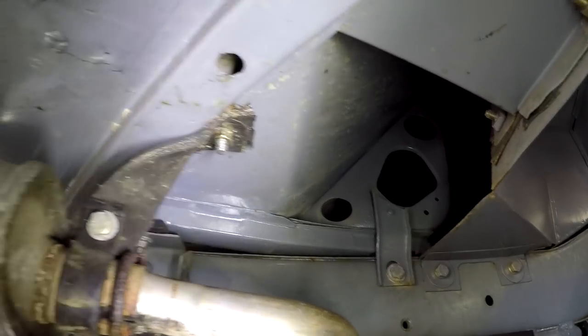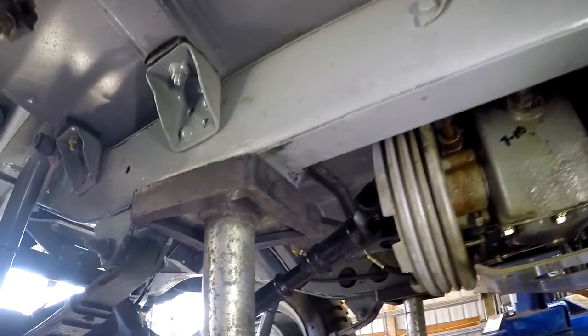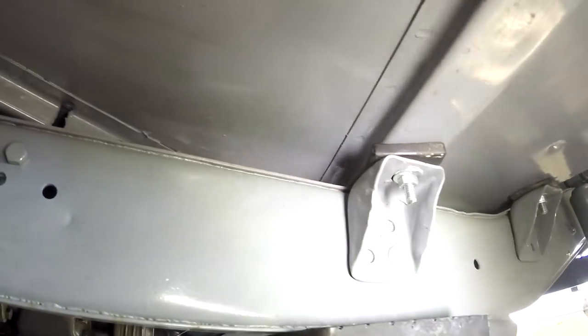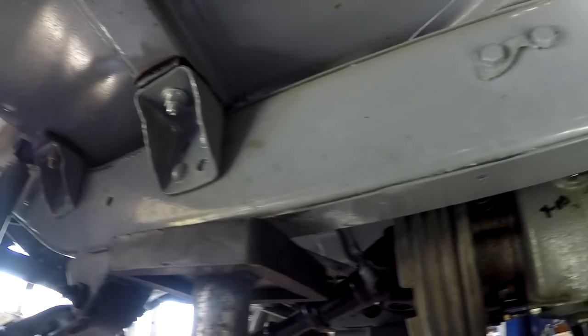It's not rusty - very, very clean. You can see two little spots that have been welded up, probably from a roll bar. Some of their welding is overkill on some things, and they weren't the perfect welders, whoever did some of the repairs and stiffening. But the frame looks in really, really good shape, the floors look nice. There's a little cut right there on the bottom, but they've got rubber mounts on the body. These old Jeeps and old utility rigs like this are easy to get to and you can make repairs yourself pretty easy. The body mounts all look good, not rusty.